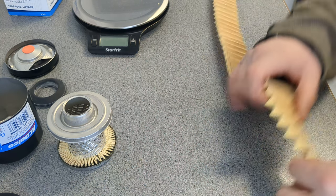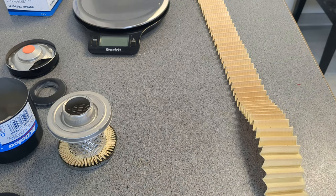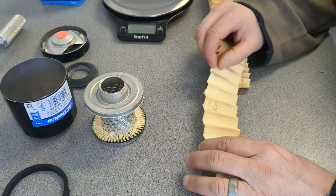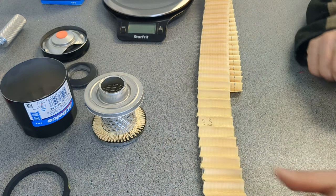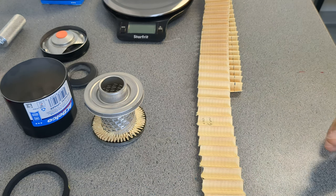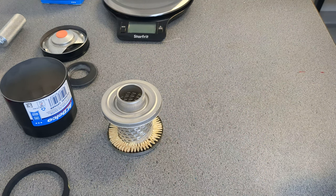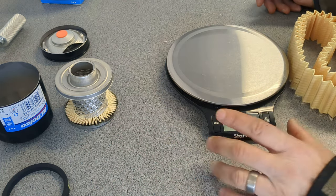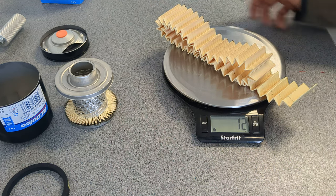It looks fine, it does a fine job, I'm sure. I'm gonna measure it and we'll get a sense of how much filtration you actually get with this filter. It looks like you might get less than the other filters. It's 51 inches long, one and three quarter inches thick. I don't think you get as much with this classification of 48 as you would with a normal PF48, but you get a better built filter in the end with it being so tough. That's 12 grams of filtration there.